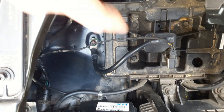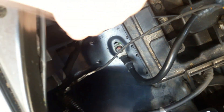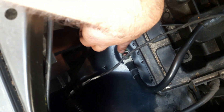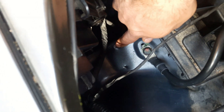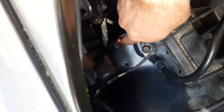One of the first things we did was remove the battery so we can have easier access to everything. The second thing I did was loosen up this screw — this is where we're going to connect the wire from the resistor to the ground. Then I made two holes so we could tighten up and hold our resistor in place. I also took up this electric tape and found the wire we're going to connect to the turn signal wire.